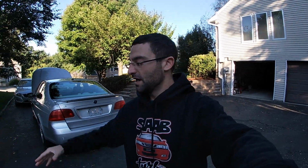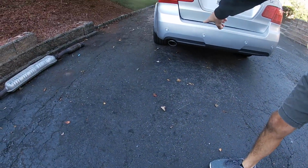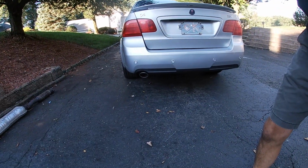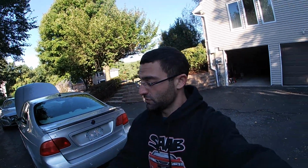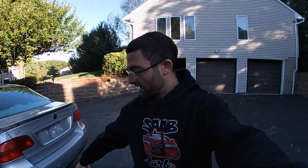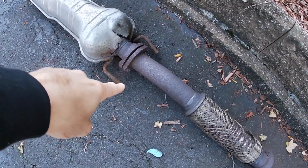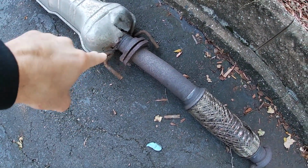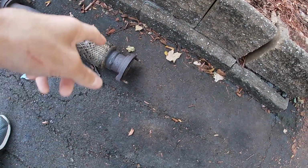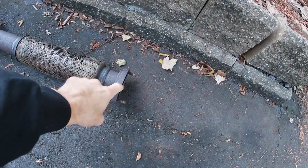Here's why. I had a bunch of good B-roll footage. I installed a brand new exhaust. As you can see, it's on there, but it's not 100% lined up yet, and that's because it's not 100% done. What I ended up doing was I bought a used exhaust system, and on one side I drilled out the studs that were kind of welded in place from the heat and age. And on this side, I ended up just cutting the bracket off of the flex pipe.